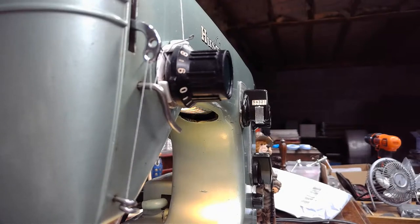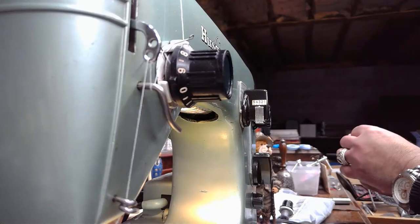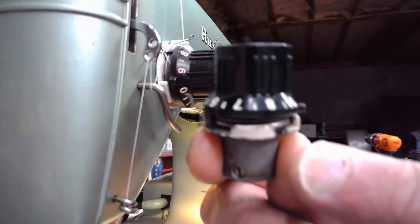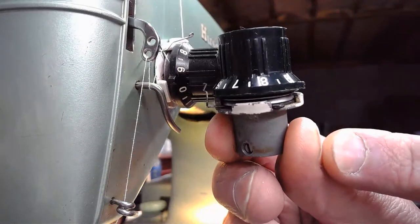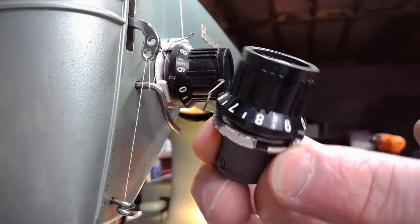So they developed their upper tensions with a small adjuster. Trying to get it out of the bag here. I'm so close to being there. Bear with me. This is going to be a slightly different upper tension. Similar, but different. They developed it with this little tab on the bottom right here. Can you see that? There's a little metal tab. And as you slide that tab back and forth, you control the range of motion for that take-up spring.